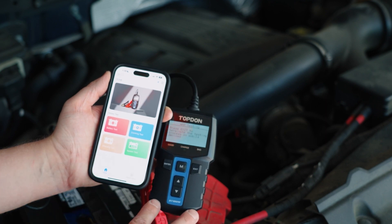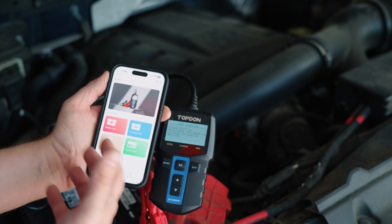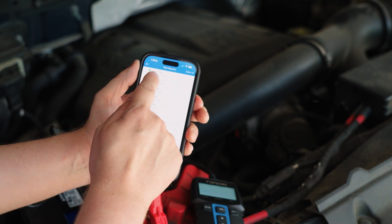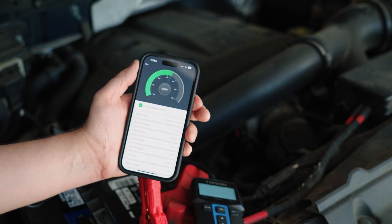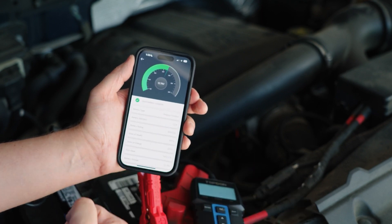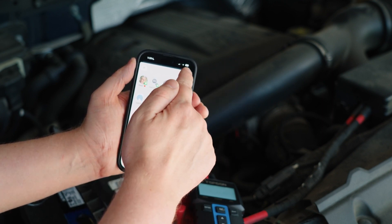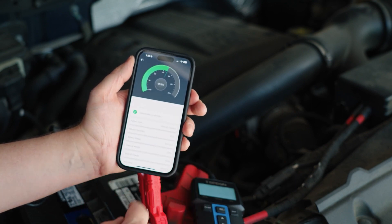Once we pair it to the BT100W through Bluetooth, you'll get a screen indicating that you're doing the testing through the app. We leave it hooked up, and we can go in and see that last battery test report we just did — today's date is 5-4 of 2023. It syncs the information back and forth even though you weren't on the app. From there, we can hit share and share it just like you would share anything on your phone — get it to the customer or send it to your customer database.